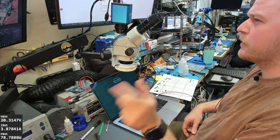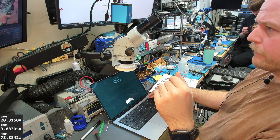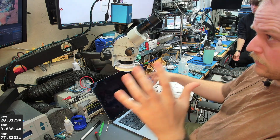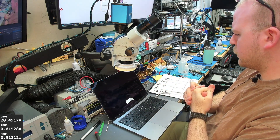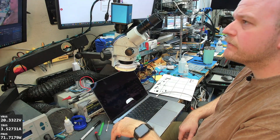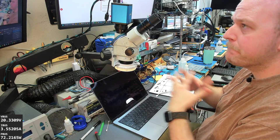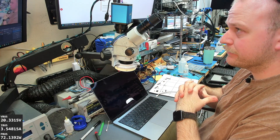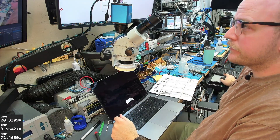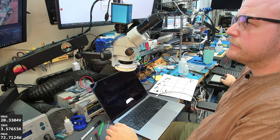The liquid damage was pretty isolated — one area on the board. We had a ferrite bead and then something for the Touch ID. Power button works. I'm shutting it down now. We'll see for Touch ID — we'll go through that setup, but I think it's going to be okay. This should be a happy MacBook. This was pretty straightforward. There was some corroded stuff and we replaced the things that didn't look too happy. That's pretty much it. Sometimes you get good repairs like this, so count your blessings, because you might get a very troll device on the next one. We'll fix those too. I hope this helps someone. Have a good day.